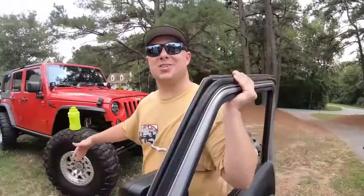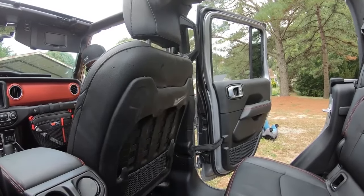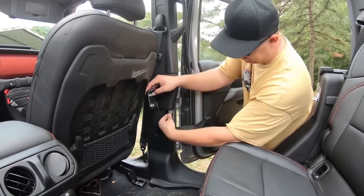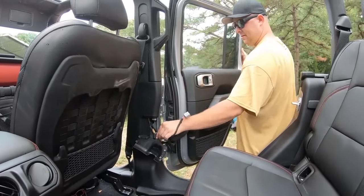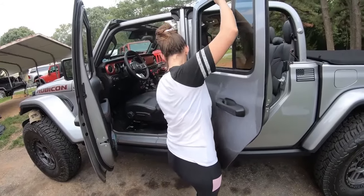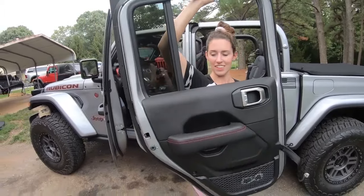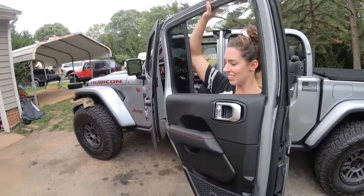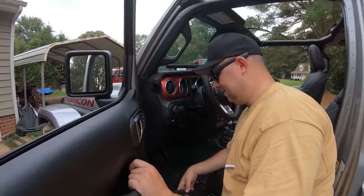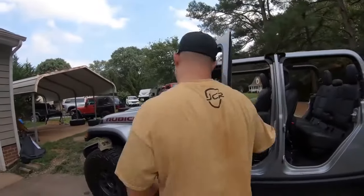Nice and smooth — and these are so much lighter than the older Jeep doors. To take off the back door connector, you've got to move the front seat forward and then remove the plastic piece; it should just pop off. This one's so much easier: little push tab, pull it down, unhook it. Easy as pie — well, pie is not actually an easy thing to make, especially from scratch, but it's very true these are straightforward.